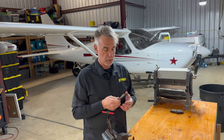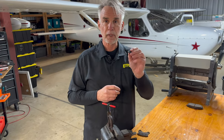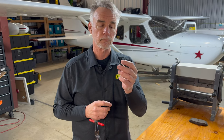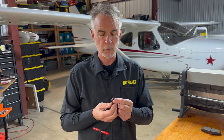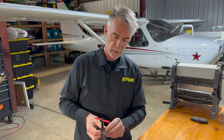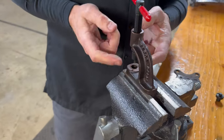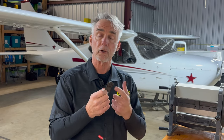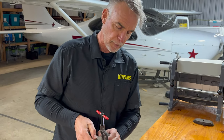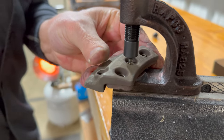We'll start the process of removing the old pad material. First, we have to set up the tool. The tool comes with a couple of pieces. The first is a little pin that is designed to push out the old rivet. There's another piece that's part of putting the rivets back in — setting the new rivets. To set up the Rapco tool, you remove this from the base and install this in the tip. The tip itself is designed to press in the new rivets, so you have to push in this piece to take the old one out. Rapco tells you to always work from the backside — the non-friction material part of the pad. Simply put the pad in and run this thing down until the pin contacts the hole in the back, and just screw it through.